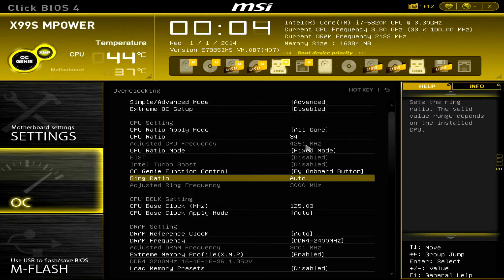Now we have the ring ratio. The ring connects the cache of your CPU with the cores and parts of the memory. Increasing the ring clock gives more performance, but the ring frequency depends not only on the CPU but also on the motherboard. On a mainboard without an OC socket like this one, you can't go above around 3.7 GHz. We'll set it to 26, which gives 3250 MHz — totally fine on this mainboard. You can try going one or two dividers up, but won't get much further.